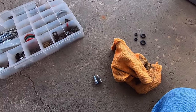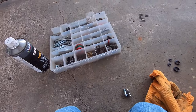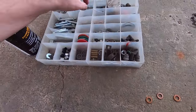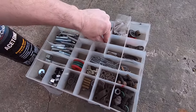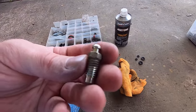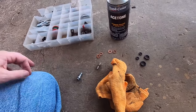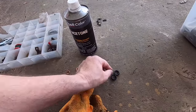While I'm waiting on the paint to dry on the brake line, I'm going to start reassembling the brake calipers. When I took the rubber hoses off the front, they only had one copper washer on — they're supposed to have two, one on each side of the hose. I've got a bunch of them. I'm going to use acetone because the bolts are zinc or cad plated and when they painted the calipers they got a little bit of cast iron gray spray paint on these. I'll wipe that off, clean them up with wax and grease remover, lube them up, and stick them back in the caliper.